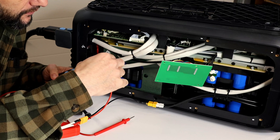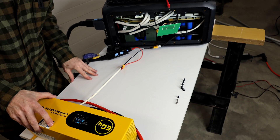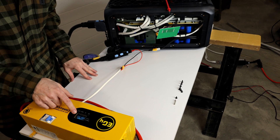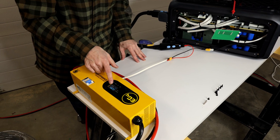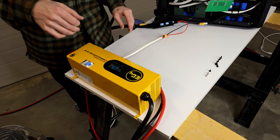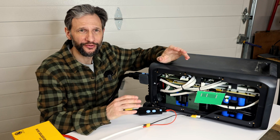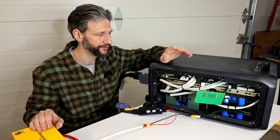Then I can charge. I'll go ahead and turn it on. We're jumping up to about 4 amps. Started out at 39 volts, it's up to 41 volts. Wow, that was so much easier — and because we were so far off the edge of the charging curve, it only took about three minutes to bring it up to 45 volts.